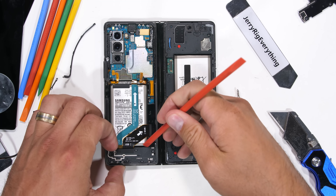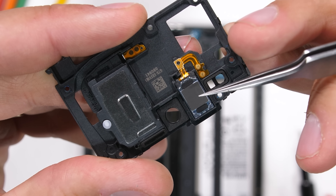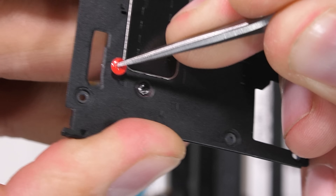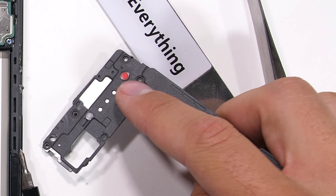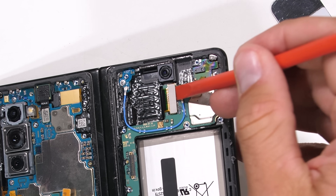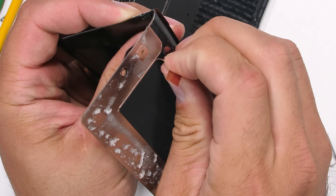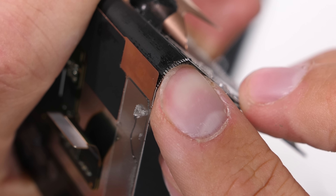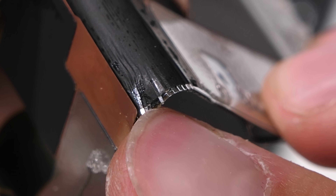Samsung is a pro at giving different versions of their phones to different markets without disclaimers. The other half has a cavity for the top loudspeaker — you can see the earpiece is also built into the same piece of plastic. Even though the phone is not water resistant, we still see the waterproofing mesh over the top of the speaker opening, and foam balls are inside underneath the red sticker. The bottom piece of plastic has the other stereo speaker and is full of those same sound-dampening balls we see in higher-end speakers. Looking at the internal folding screen, we can see it pops up through the frame above the battery and plugs in just like a little Lego. With the large screen removed, we get our first look at the silver metal structural side supports and the copper layer, which helps keep the whole screen cool. The coolest thing is the center portion — since a solid piece of metal would be too stiff to bend, Samsung has used little sticks of aluminum like a fence or a roll-up bamboo yoga mat, giving the flexible screen support and only letting it bend in one direction.